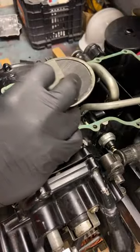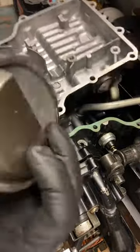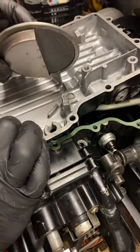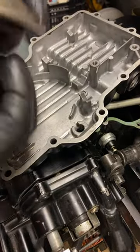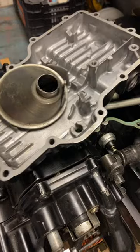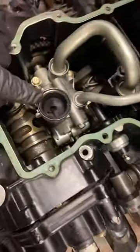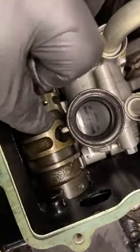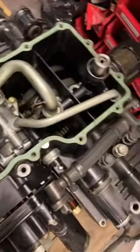So what we have here, this is where the used engine oil gets squirted in, the sediment settles in here, and above it, this thing is hovering. This is sucking in the not frothy or foamy engine oil, and therefore it has a sieve on it. Let's see if it's stainless. Maybe some low-grade stainless, like 304 stainless, like the exhaust material. So at this point, I just put it in the bucket. The engine oil gets sucked into the oil pump, which is sitting here. Here is a shift shaft or some such thing, and from this oil pump, engine oil goes everywhere.